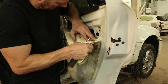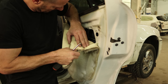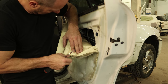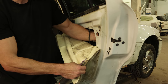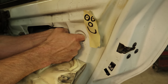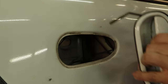Pull the water barrier down very carefully so we don't rip it — just enough so we can get to the door handle bolt. Takes a lot of patience not to destroy it. Unclip the door handle, unbolt it, take the bracket out of it, and pull the door handle out. There's a dent right above it, so the body guy needs a little room in there.